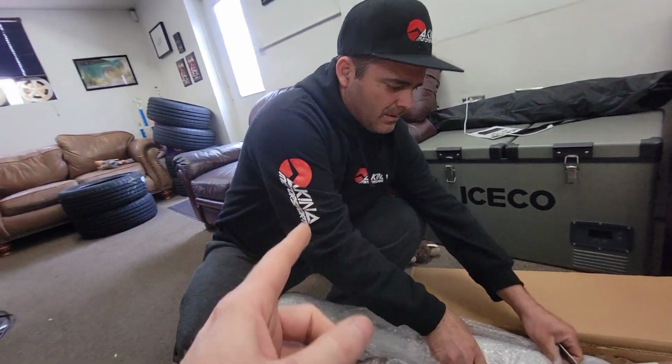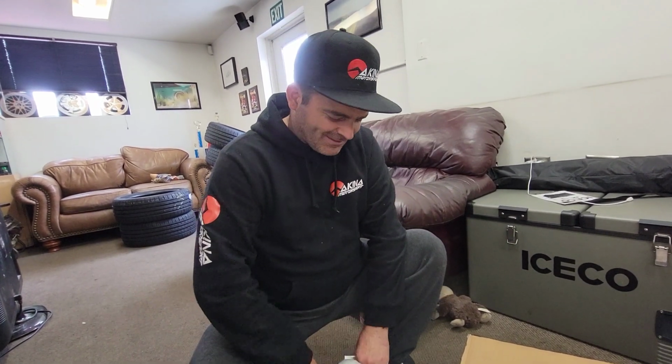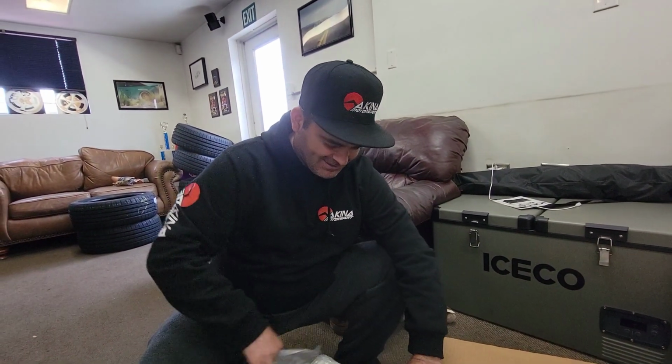I was talking with Pinto about spring rates. He said his car in Portugal is 8K front? 6K front. There's no way for S chassis. S14 was 6K front. I told him I run 12K and he thinks it's crazy. He had a car with 11 and he's like, I had to sell the car because the springs were too stiff. The green blue car? Yeah. What is the suspension rates? 12.